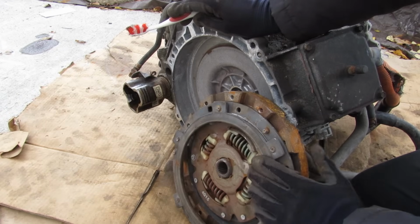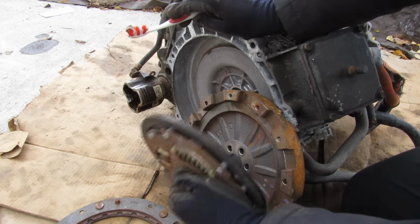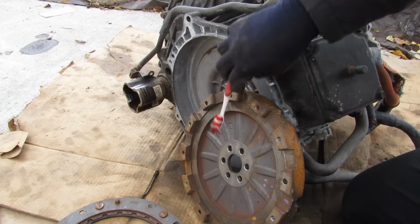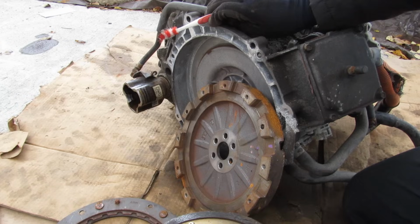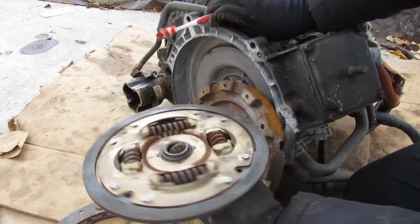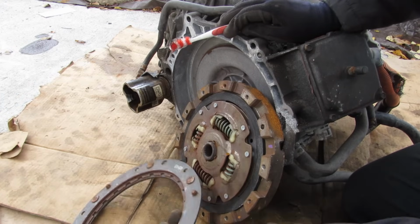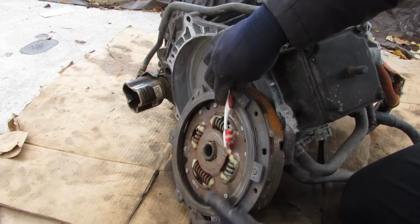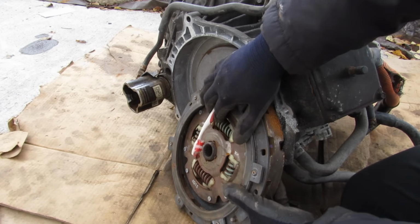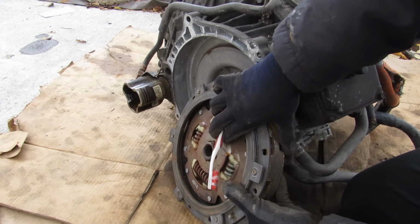Now the Toyota Prius, they've actually opted to use a manual transmission style flywheel. You can see this here would be the flywheel. It's got some weight to it, and that's going to be mounted to the crankshaft of your internal combustion engine. Then you've got a clutch or a torque damper. It's got these springs inside here that's going to mount inside of here, and then you've got the equivalent of a pressure plate, which is going to squish down on that clutch. Now this clutch is always applied. There's no engagement and disengagement of this clutch, but essentially this is what forms your flywheel assembly.